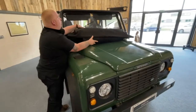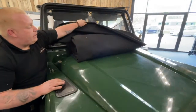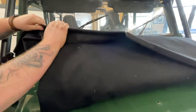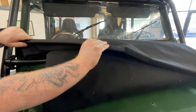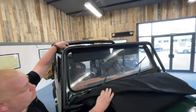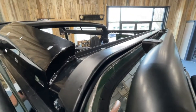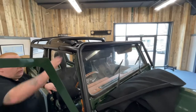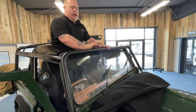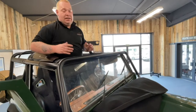Make sure you place the hood as close as you can to the front of the windscreen so you can get to the front of the hood. The front of the hood will also have a plastic ridge which will slot into the front top of your windscreen. If you climb into your vehicle, it's probably best to remove your seat bases to save treading all over your seats.